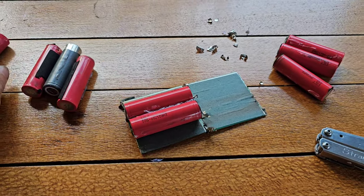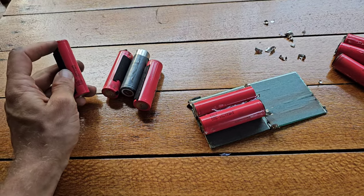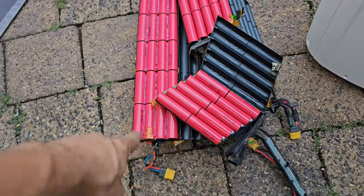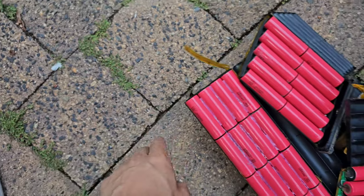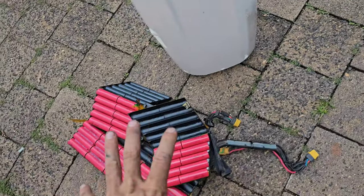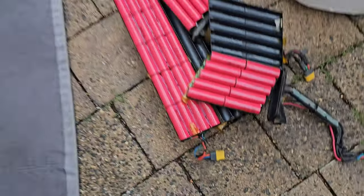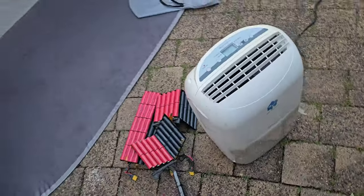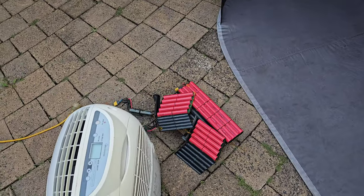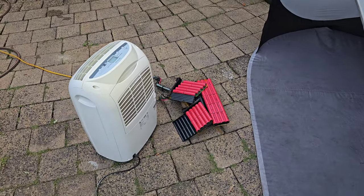I think I figured out what happened. When I checked it yesterday all the voltages were fine, then I checked it again in the morning - one cell was totally dead, breaking the series connection. When I fixed the cell it reconnected the connection, so the power was flowing through the BMS and through all of them, and I'm guessing it was slowly destroying itself. I literally fixed it with re-soldering and then maybe half an hour later - I made lunch, did some editing - nothing was warm or anything. Then I came back and started hot gluing and it just went. I'm guessing fixing the cell completed the link, letting it get destructive again. I am so lucky it didn't go up last night and burn up my whole unicycle. I'm going to check my other packs and make sure there's no water getting to them. Obviously water and batteries don't mix - lithium and water react and create heat. I took apart all the packs and there was a little bit of moisture in these two. I'll run a dehumidifier overnight just to make sure it pulls everything out before I put it all back together. Better safe than sorry - I don't know how comfortable I'll be sleeping next to my unicycle knowing it could burst into flames. Hopefully this takes every little ounce of moisture out and I'll have to order a new battery soon.